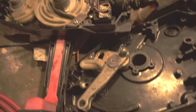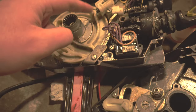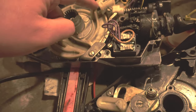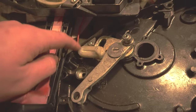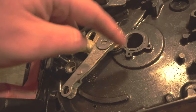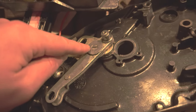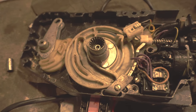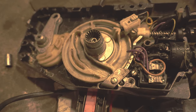I've pretty much put this thing back together. It was really very easy to work on. The issue with the switch seemed to have to do with the grease and the ball bearing — once I took care of it, the arrow goes back perfectly to where it should point and everything seems to be working correctly. A few assembly tips: make sure you put the plastic piece in at the same time as the little triangular piece below it, because otherwise you won't be able to get the plastic piece in. Also, this washer has two sides, so make sure you have the correct side. Putting the disc in was a little tricky, but nothing too difficult.